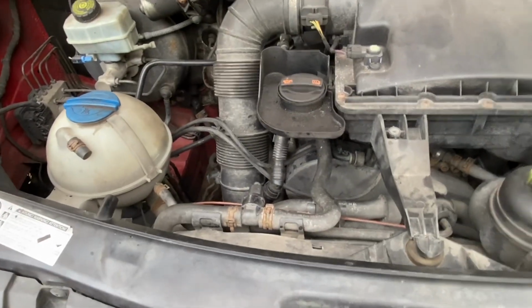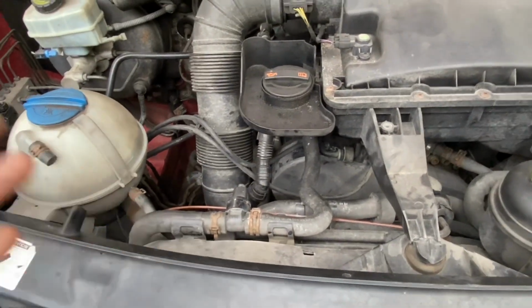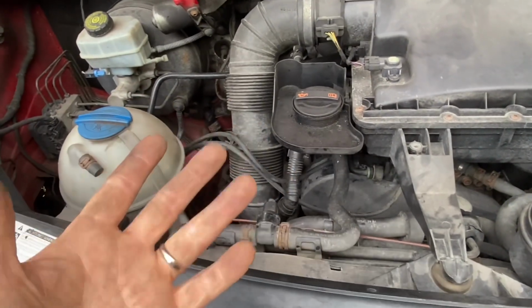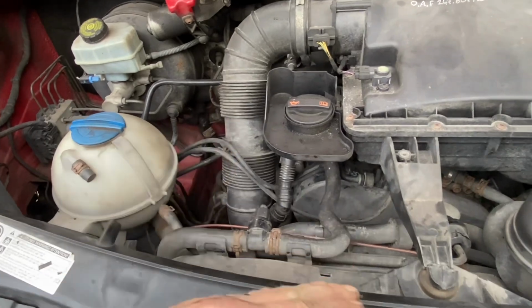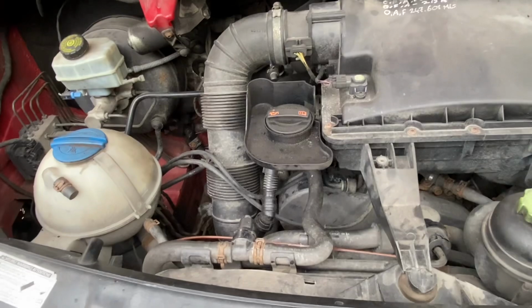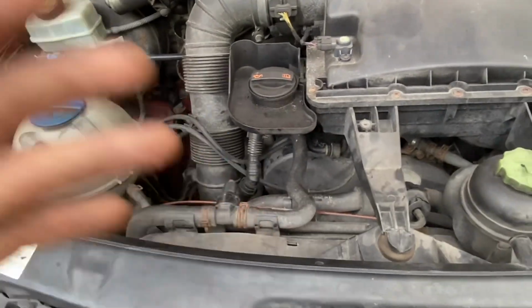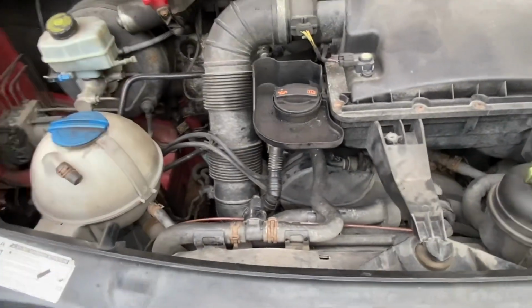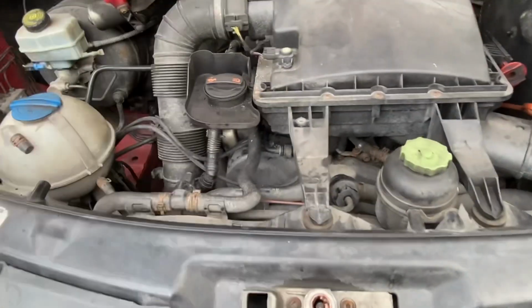Now, when I was in here rummaging, I just saw, and I thought intermittently, weirdly, that my vacuum was too low. I was looking for about 25 or 30 inches of mercury, close to 0 kPa. That's what I was looking for, but I wasn't getting that. Intermittently, my vacuum was too high. And as I said, my battery was flat in my phone, so I couldn't show you, so apologies.